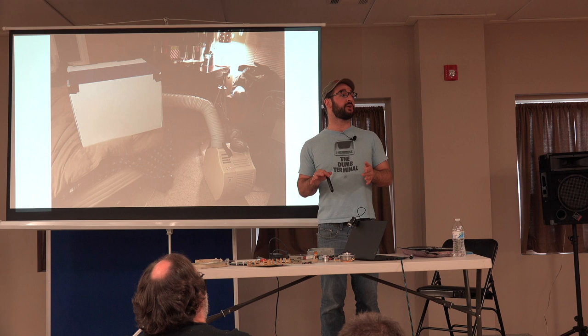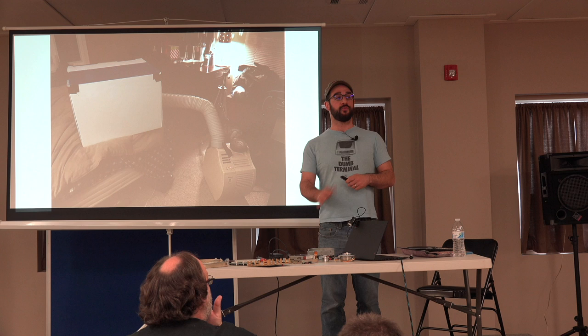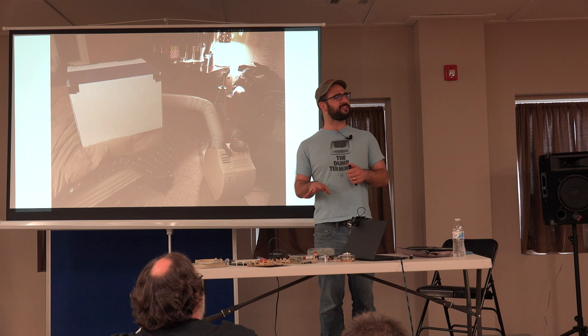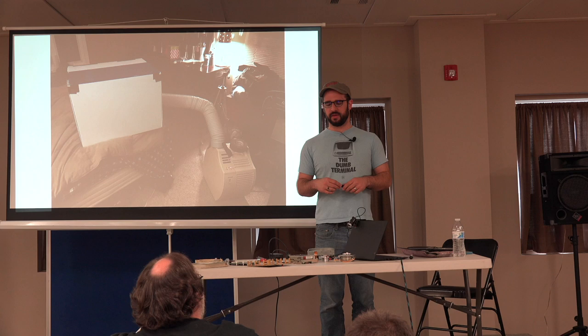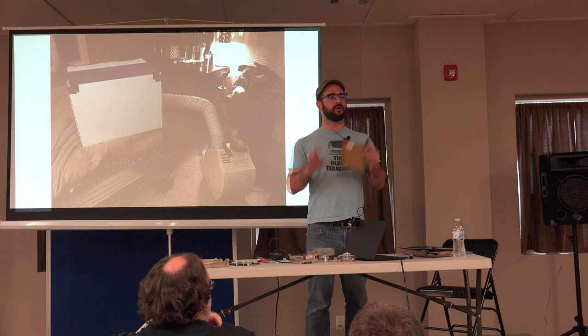This was on the market in 1984, and they were developing it from like 1982. I think this was definitely a higher end drive. They were trying for more performance. It didn't work out that way. A 10 megabyte ST412 is actually a little bit faster, but I think this has a little bit better error correction. In the original mounting, it has a card cage, and it's got an intelligent controller and a servo controller and an internal serial bus and all this stuff to try and make it very reliable.